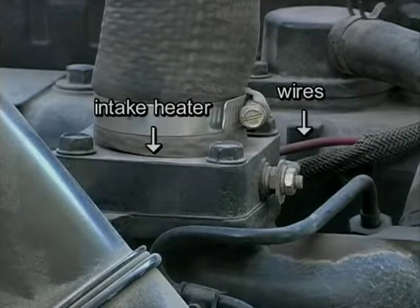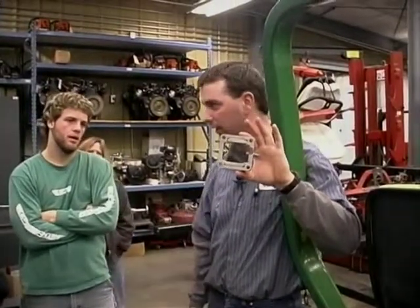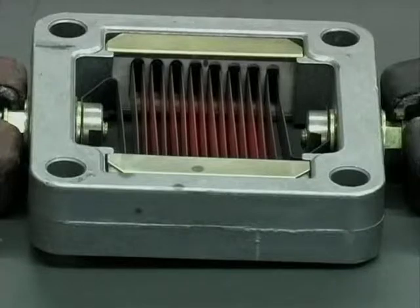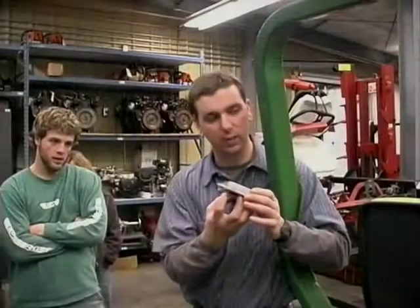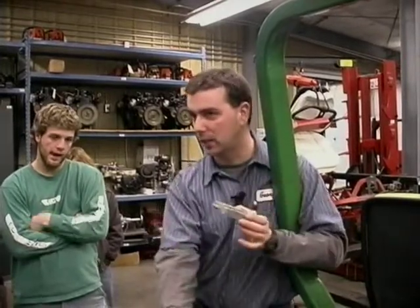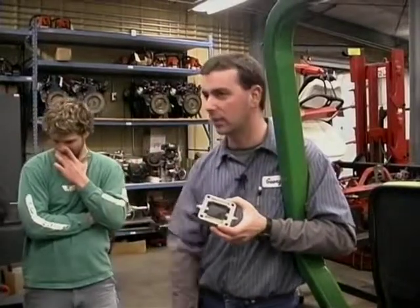You see the wire coming up? It attaches — there's a thread there. If I was to take it out and look at it on the end, it's like a toaster oven. The idea is when I hit the glow plugs, it's not actually activating glow plugs — it's activating this intake heater. These wires will glow red hot, and when I crank the engine over, the air will pass through these and it will suck warm air into the engine. I'm preheating the air before it actually gets into the engine, trying to get that temperature up so that I can fire this engine off.